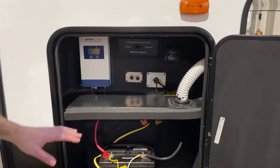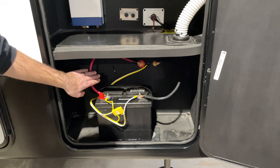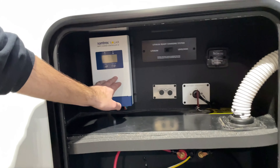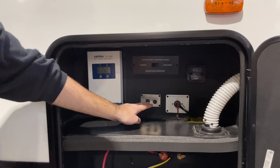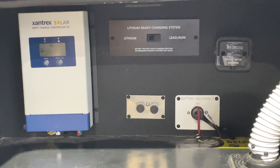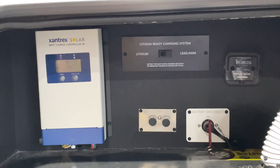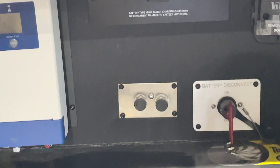In your battery compartment, you have your battery with space for two batteries if you choose. You have larger cables — those are your main converter cables — and smaller cables for your solar connection. Up on top is your solar controller, which is more or less there for observation. You have two threaded dials that control your main two slide rooms. If you have one of those valves closed, it will prevent that slide room from extending — useful if parked against a tree or building where you don't want one side to come out.